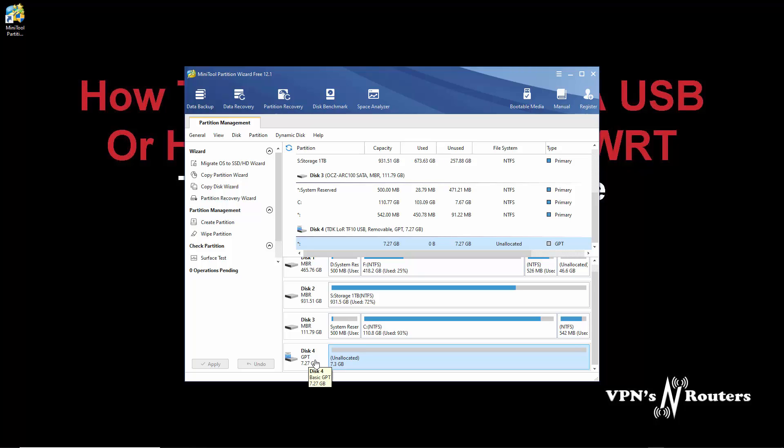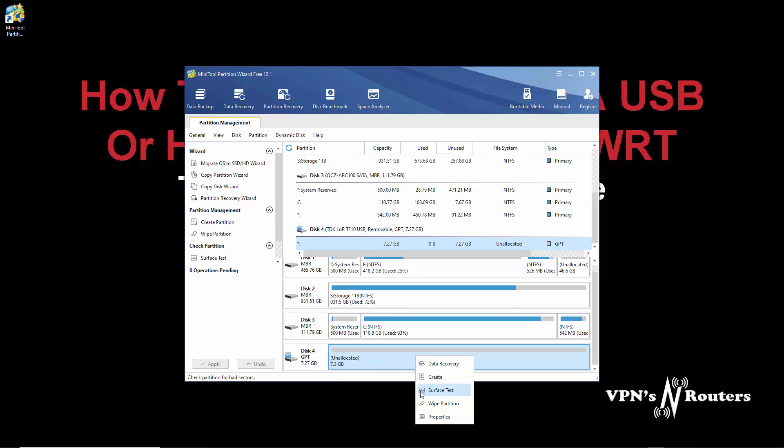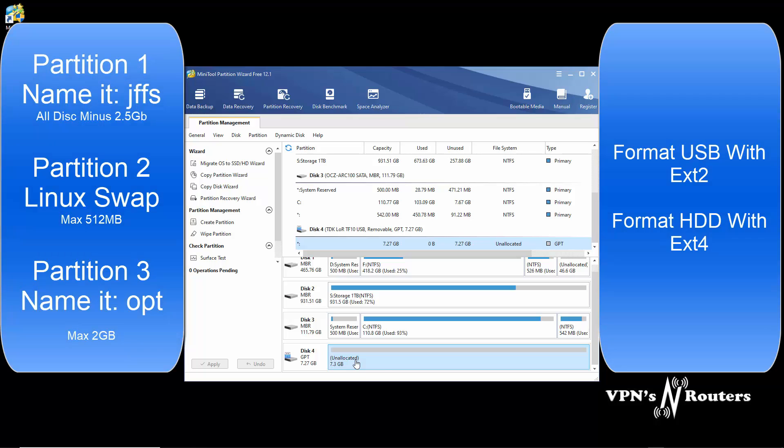The reason I do that is I believe it's just the way the operating system reads it. If you're on MBR, there is a way of converting it - if you click on there, you can convert it. This is unallocated space at the moment. Click in the unallocated partition space and click Create.